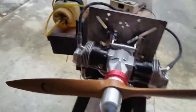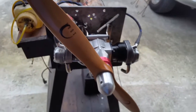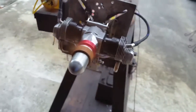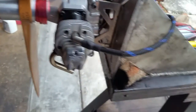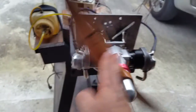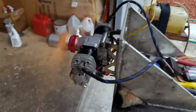At 900 to 1000 RPM, if you have a heavier prop like a Dyna-Thrust or something with a flywheel effect, it might run better at idle. I have to bring the idle up a little bit because it's too low — I left it like that since yesterday when the engine was hot. Right now it's probably around 1400 RPM.